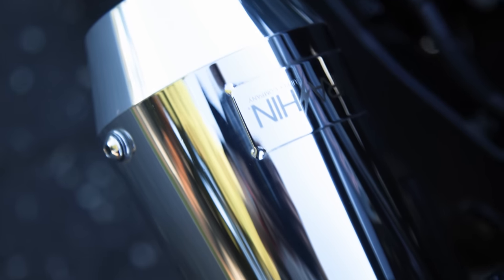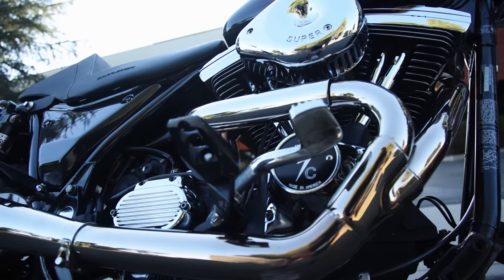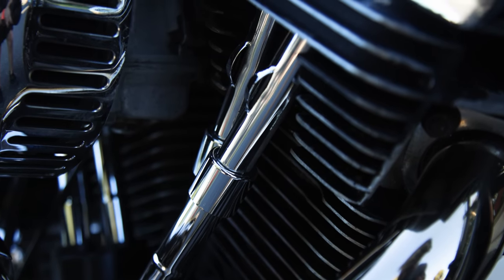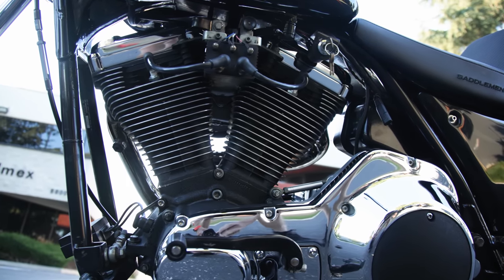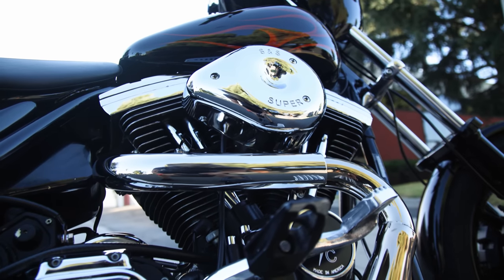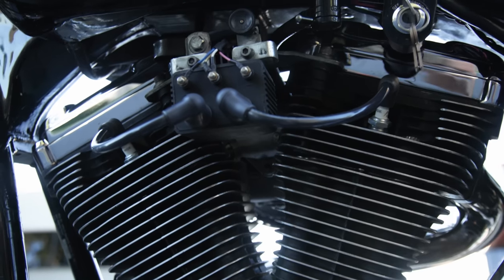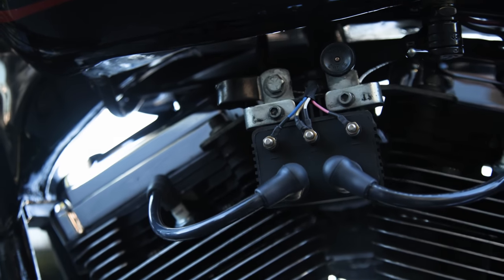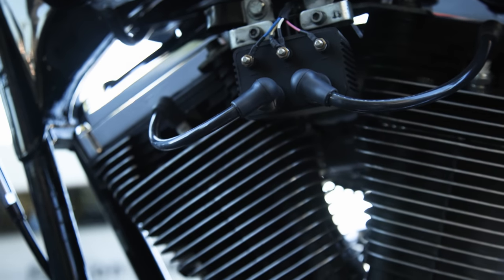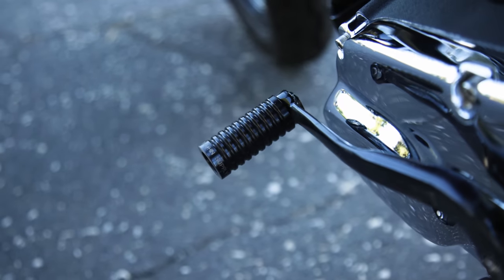This is the Thrashing OG system on your Evo, with a removable baffle. Are you running a stock engine? I see you have a Mikuni and an S&S air filter with the OG Thrashing pipe — anything on the inside? Yeah, it's a built 80-inch Evo. It runs real good; it's super fun to ride. My last bike had a built 120 in it making mid-120 horsepower, and I went from that to this and wasn't really that disappointed. It's high-compression Branch heads. I don't know what cam is in it because I bought it that way, but I had to tear it all apart — it had bad blow-by when I bought it cheap. I re-ringed it, honed it, put it all back together and it actually rips. Stock five-speed.